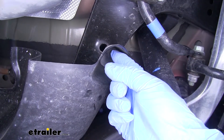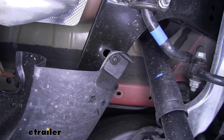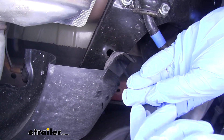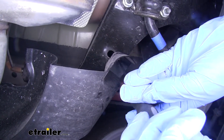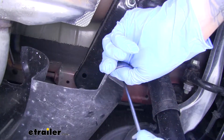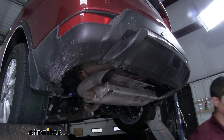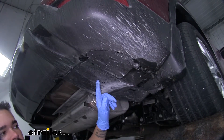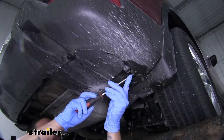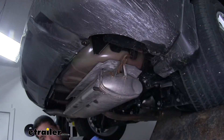We're going to have one more plastic fastener all the way towards the front of the vehicle right by our rear axle. Take a Phillips screwdriver and very loosely and gently unscrew that push pin. Once that center comes out, pull down on the panel a little bit while unscrewing it and it'll pop out. Then we can pull the panel down and set it aside. On the passenger side we're going to have another appearance panel to pull down and the push pin fasteners as well as that plastic fastener are all going to be in the same position, so we'll pull those out and pull that panel down as well.